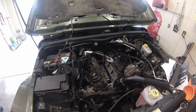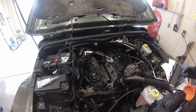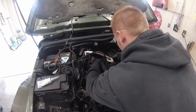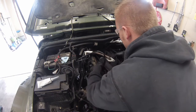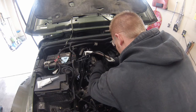Once you have your RTV in place, just gently set your gasket in there, lining up your holes — the bolt holes right there. And then of course you can just use your ports as a good guide as well.